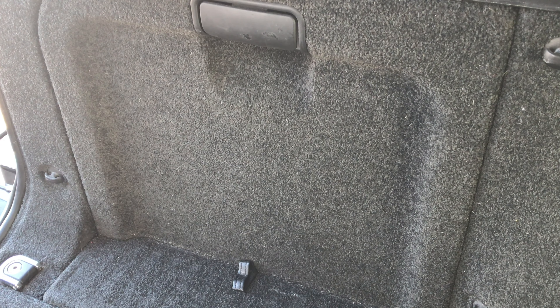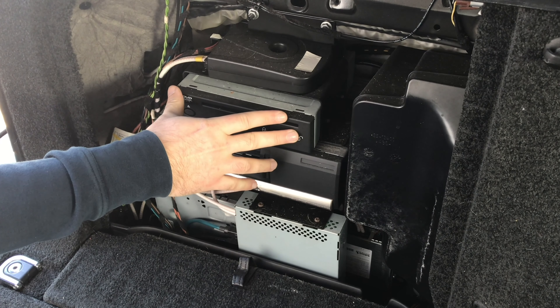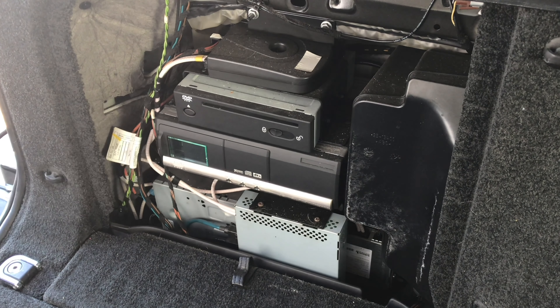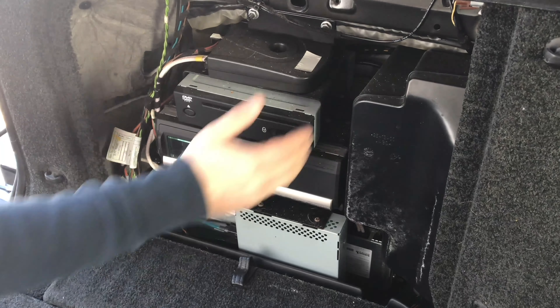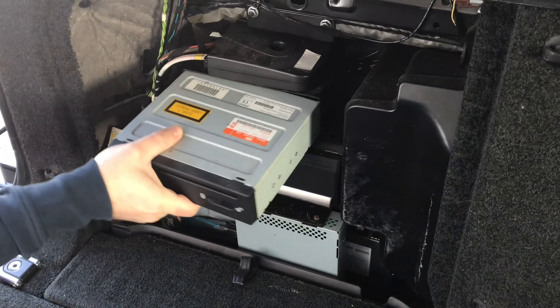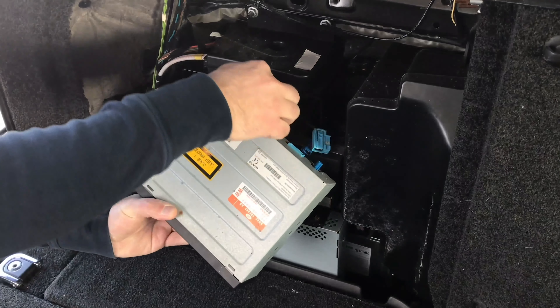For demonstration purposes: our 2013 Cadillac CTS came with a factory rear view camera, but we installed front, left, and right facing cameras — this is how the configuration should look. Scrolling down, on the left side you have forward-facing camera settings with two options: Manual (driver activates only) or Manual Speed Check (good for parallel parking — rear camera comes on in reverse, and front camera automatically activates at speeds up to 10 mph when shifted to drive). On the right side are settings for left and right lane watch cameras: Manual, Manual Without Speed Check (active at any speed), or Manual With Speed Check (automatically displayed with turn signals above 50 mph).